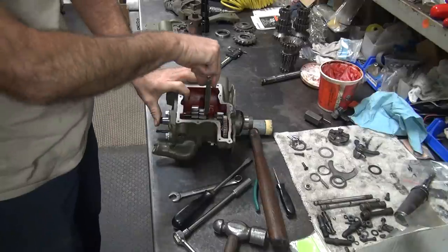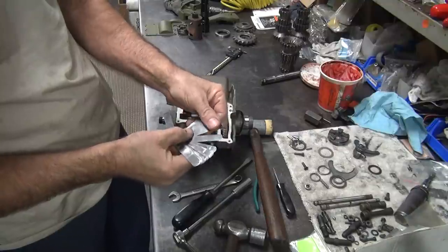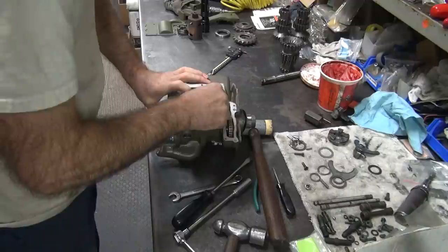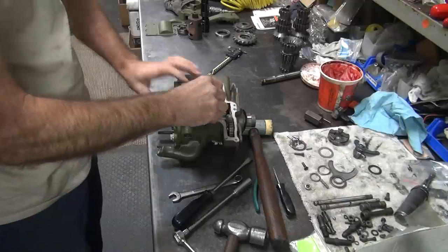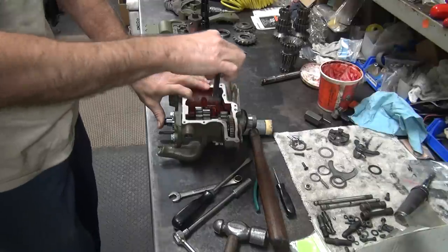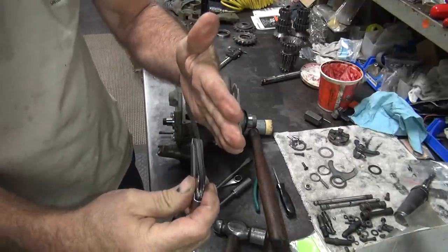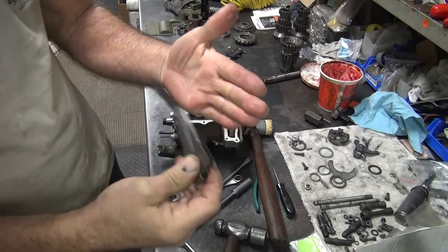Okay, we locked it. See, it's not coming out. So we got less than 12. So we got more than 8, less than 12. So let's try 10. Way on the inside of the plate down there, it's tight at 10, way in there. But up here we get to it easy. It's loose. So the plate is basically hitting like this on the bottom. Underneath the gear we can't see it, but up here on top we've got a lot of clearance. So you always got to measure the tight spot.